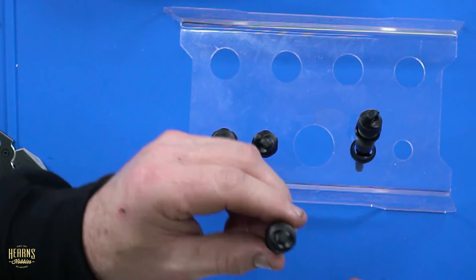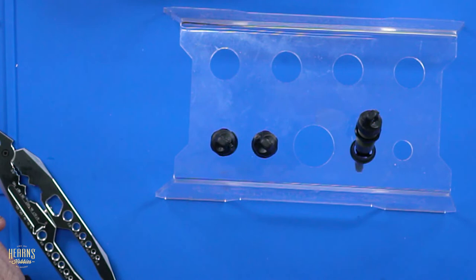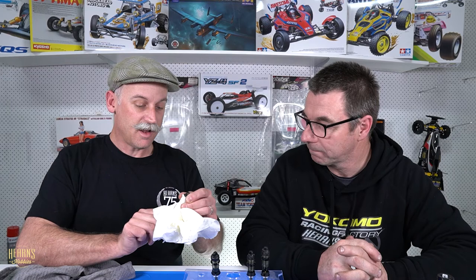I'll tell you what, I'll help you out with this one. I'll put the cap on the bottom. Put the cap on? Yeah. Just making sure that screw is... Because the last thing you want to do is cross-thread a new shock cap, no? That's right. Especially one of mine. That is usually the death of these shock caps, isn't it? Actually, no. Because they're 2mm, you can get a 2.5mm screw and just tap it in. It's really good about that, the way they are. It's quite easy to resurrect it if you do actually strip it eventually, which you will do. It happens. I've stripped plenty.